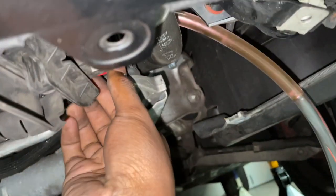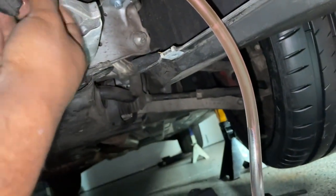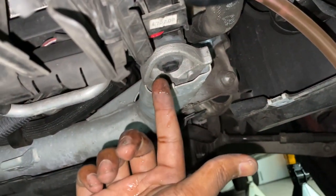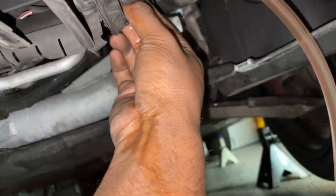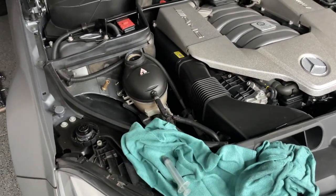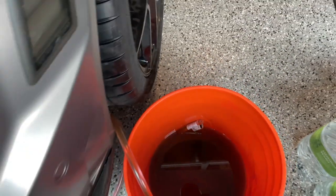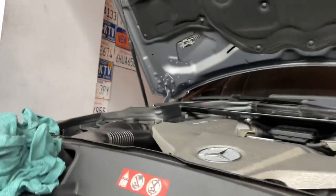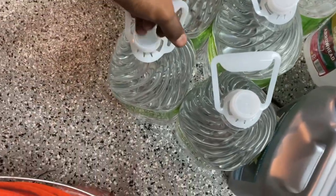Just loosened up the drain plug a little bit and we can already see fluid starting to come out. A word of caution: don't loosen this too much or it'll drop on your hand. You'll find a sweet spot in the middle and it should drain fine. Be sure to remove your coolant cap on the reservoir during the drain process — this allows the coolant to flow a little better with less pressure. Big fan of this radiator design; the ML63 is the exact same way with the petcock drain plug solution.